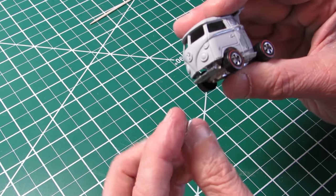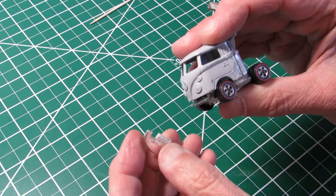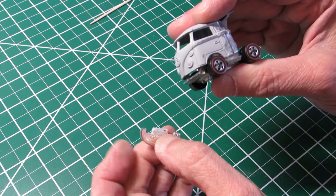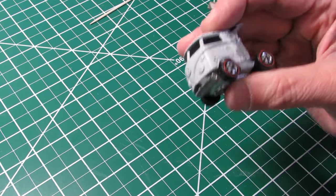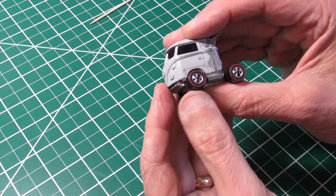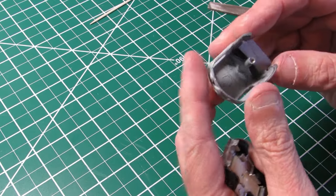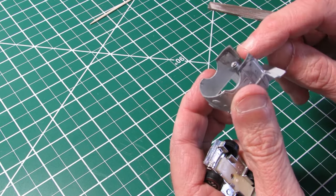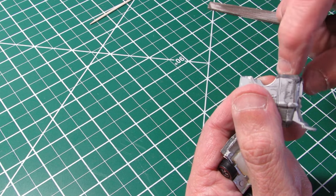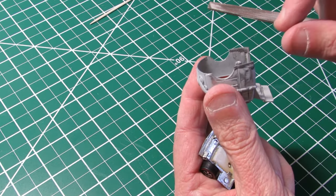So as you can see here, I had cut the combi bumper off the original combi base, notched it so that it would fit into the heavyweight base, and made some modifications to the heavyweight base. I had to file away a couple posts and clear things up near the front end, like the headlights on that base. I did thicken those inside walls using JB Weld. I love JB Weld. It works fantastically.